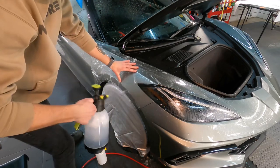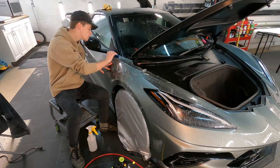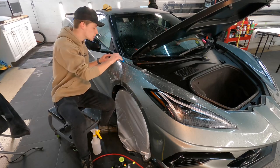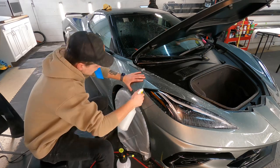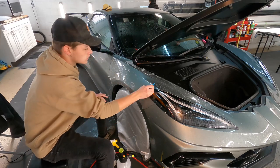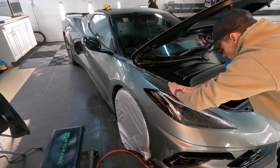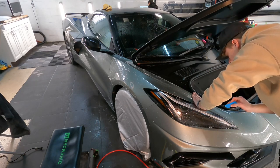We're going to jump over onto the fenders, working our way from top to bottom. The fenders are going to be done with the assist of a plotter. With the software that communicates with the plotter, we can cut out our own pieces and customize coverage anywhere we want. We can blow up the pattern, shrink the pattern, or use a section of the pattern, really customizing our installs, and we're going to wrap around every edge that we can.